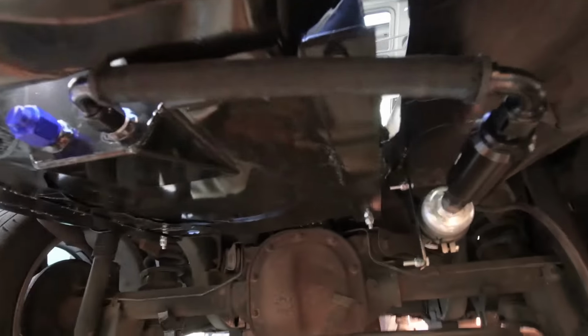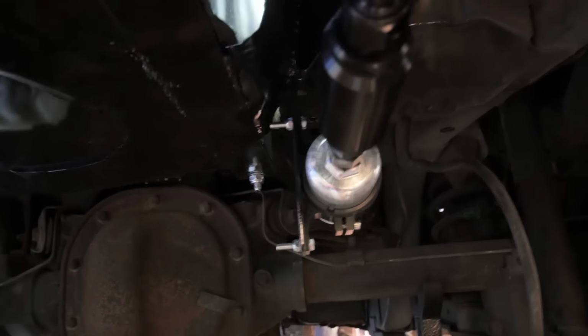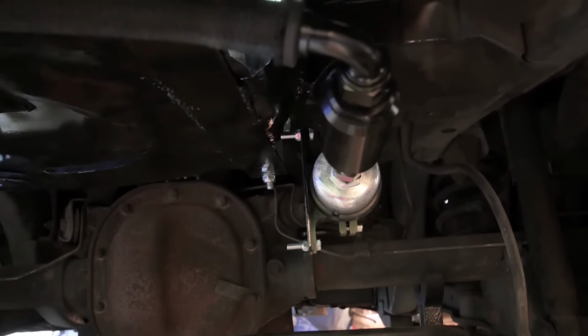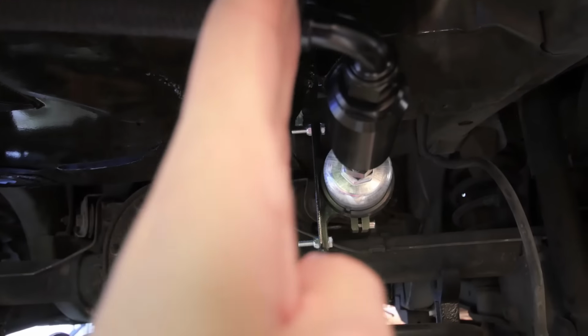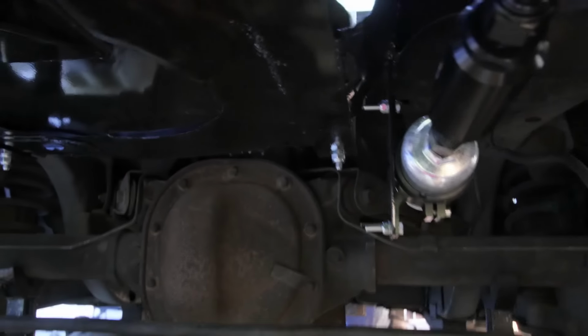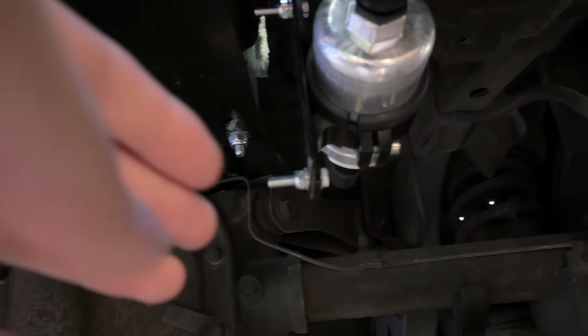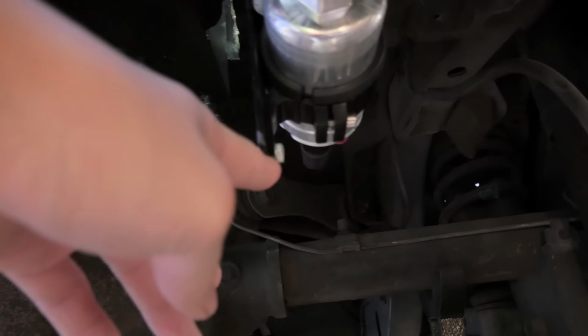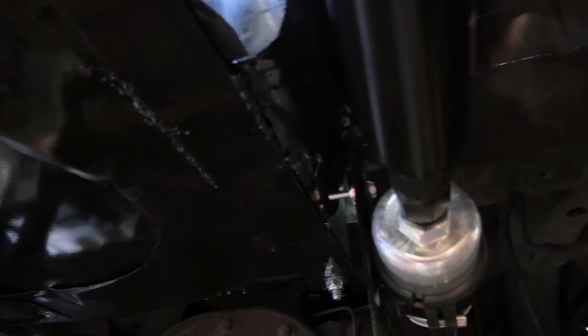But as you can see, I did fix this mount so that it is now straight. As I said before, it was kind of leaning like this. So now I just bent it back straight and I went ahead and put some nylon lock nuts on there. So those are actually locking nylon nuts so that won't come off. But yeah. And then down here,